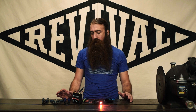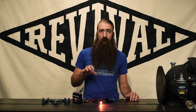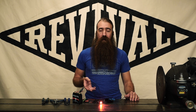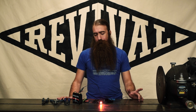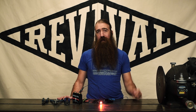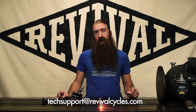That is the overview of the waterproof power distribution modules and the circuit breakers that are compatible with this system. They do work with standard fuses, so if you were ever somewhere and something happened with a circuit breaker, you could always just replace it with an ordinary mini fuse. Honestly, circuit breakers are great — they don't wear out, they don't go bad, especially the solid-state ones, which are just about bulletproof. Thanks for watching. If you've got any questions, give us a call or send us an email. We're always here to help and we want to see you get your project on the road.